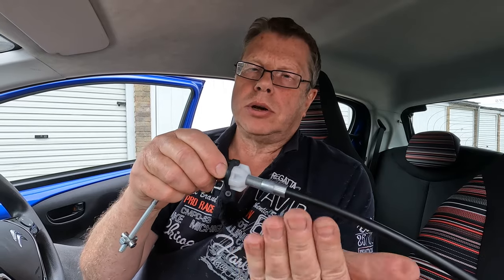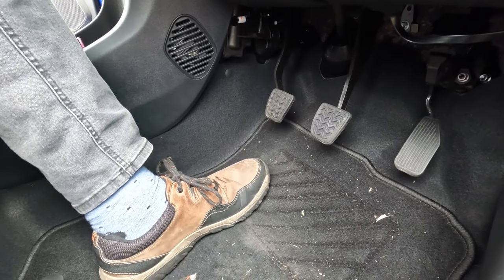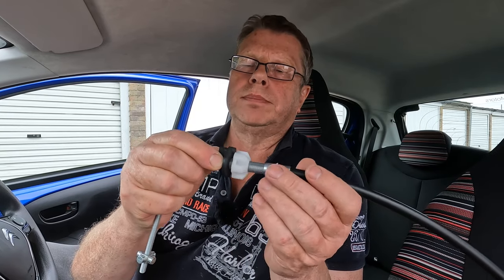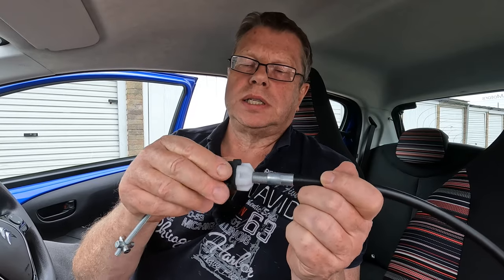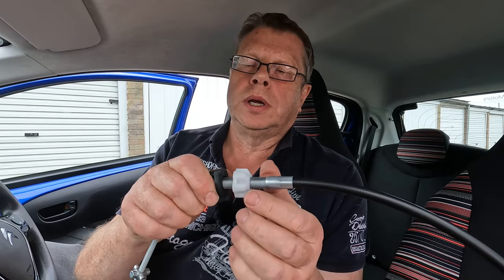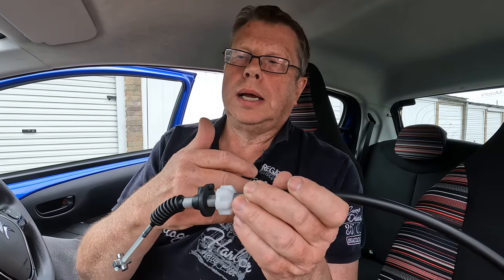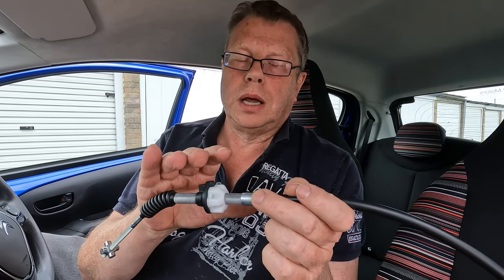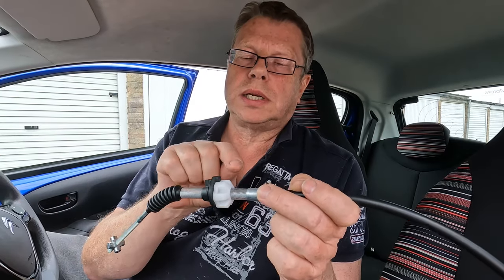What we need is an assistant to tuck the top of their shoe underneath the clutch pedal and just lift the clutch pedal slightly. By doing that the cable will ease away from the rubber grommet and we can rotate the adjuster easily, then they let the pedal drop back to its normal position and the cable will re-engage with the fixation pin. Anti-clockwise will tighten the cable and pull the pedal upwards; clockwise will cause the pedal to lower. We need to adjust this at every service as the clutch wears.